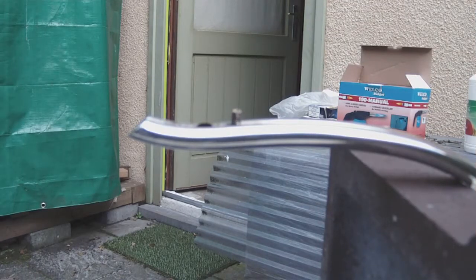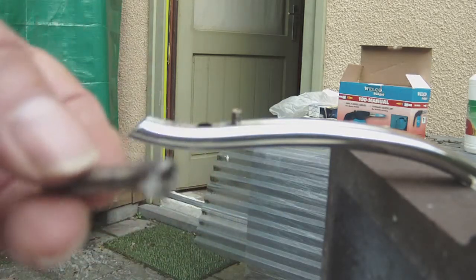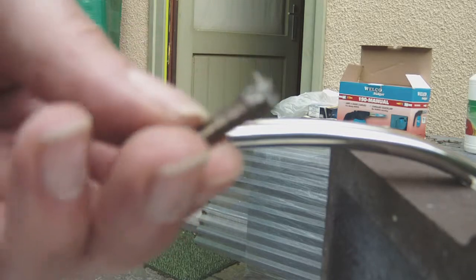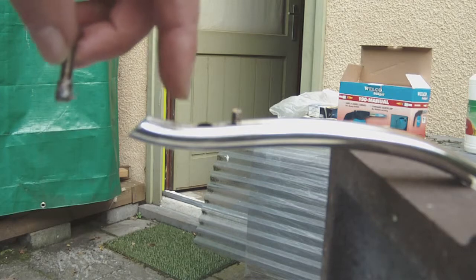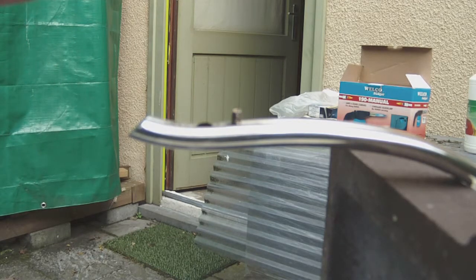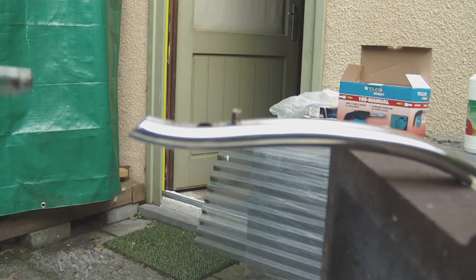Okay, now we're going to solder the leg, and I attached a little copper stub, well, in fact a leftover of the first stub, and I screwed the stainless steel screw in it. I'm going to pull a little bit of solder here, and while it's still hot I'm going to set the stub right into the silver solder, holding it by the stainless steel screw, and wait until the solder sets before I release it. So that's the plan.